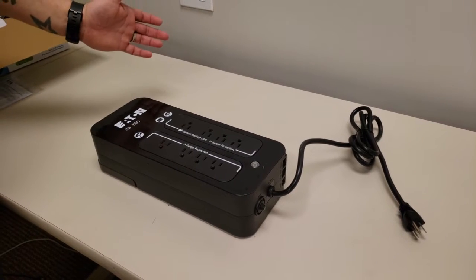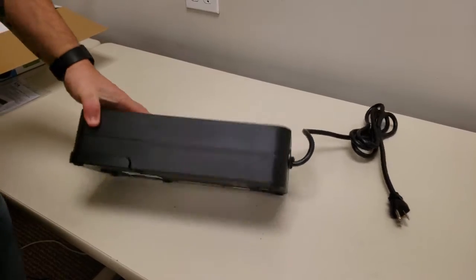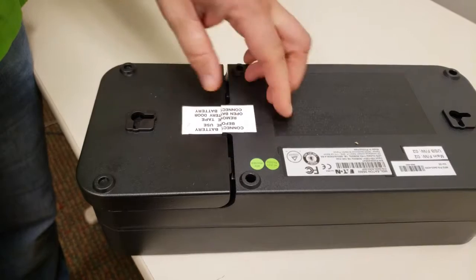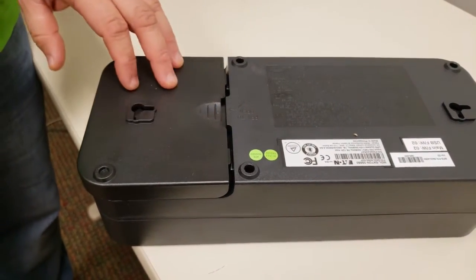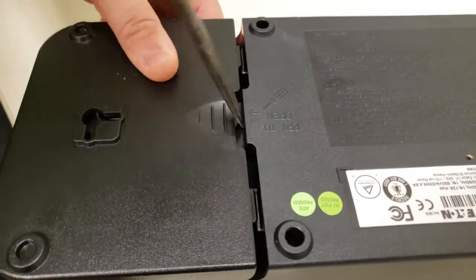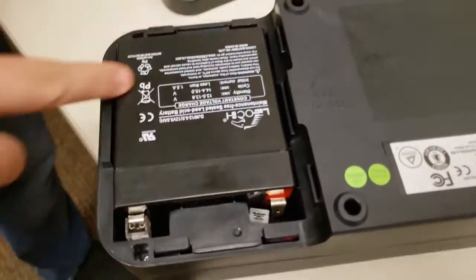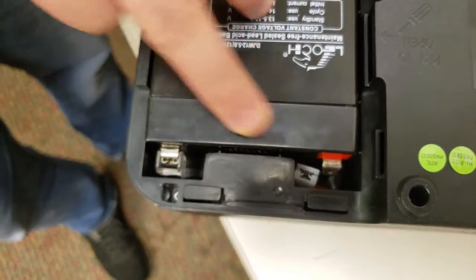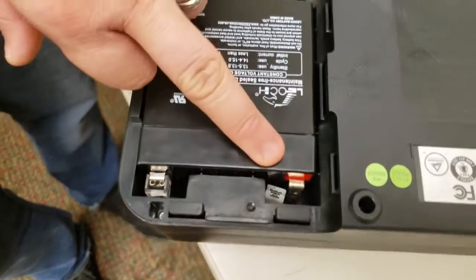The first thing we'll explain is how the battery is hooked up inside of this. If you flip this over and take this little piece of paper off — it says 'connect battery before use' — take that off. Here you have your battery door. It's easiest to use a flathead screwdriver to just put in here and pry that back. This cover slides off, and inside you'll see your battery. You have your positive connection here and your negative lead — the negative lead is generally always hooked up. You just have to connect your positive.